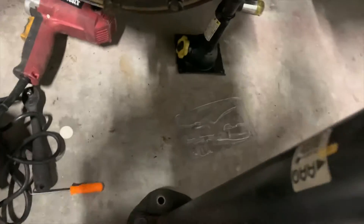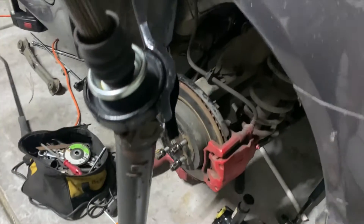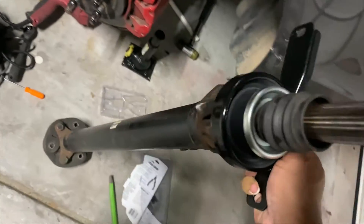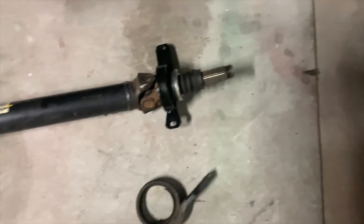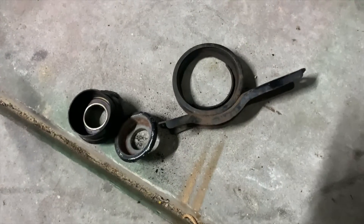You can look up under there - we got the exhaust out of the way. Here's the driveshaft. We needed to change the carrier bearing in the driveshaft anyway while it was out because it was vibrating on takeoff and making a knocking noise. So we took the old carrier bearing off and put the new one on. It wasn't that bad - we knocked it off with a chisel.